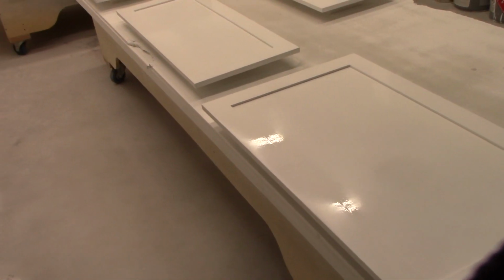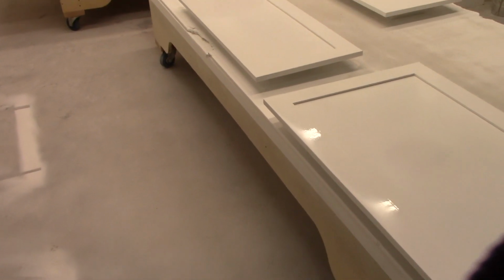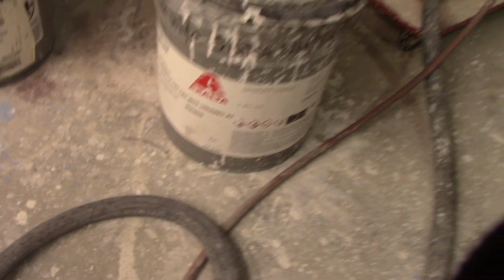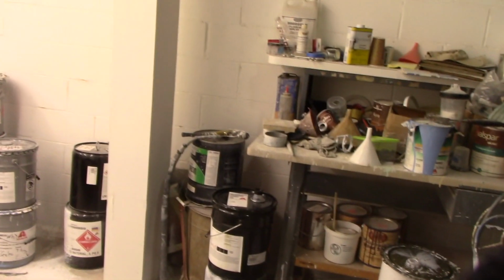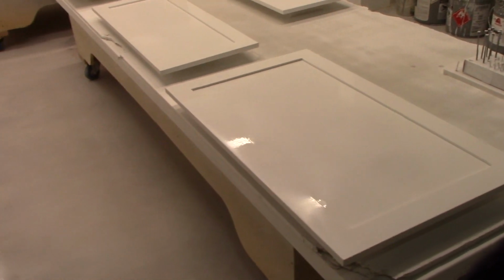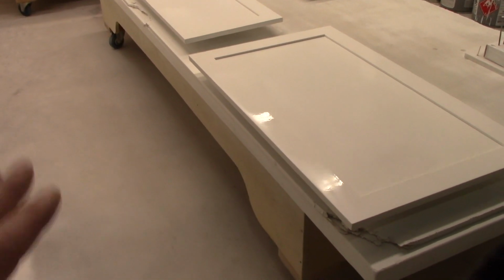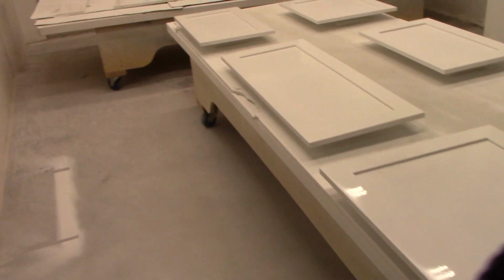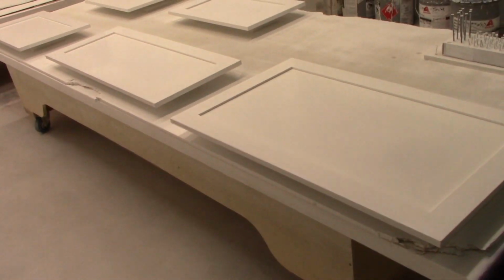That makes sure you get a more even coverage with your gun, and you kind of eliminate any striping effect, all right? Now, it's not so critical now because this is only the undercoater that we're spraying right now out of that gun, which is sitting over there. But yeah, there's two full coats laid on flat, boxed, but I've got probably six or seven coats along the edges. That's for a couple reasons.